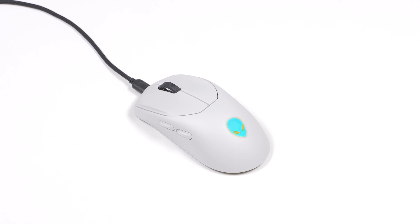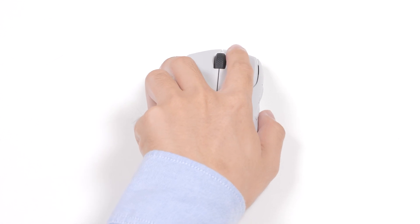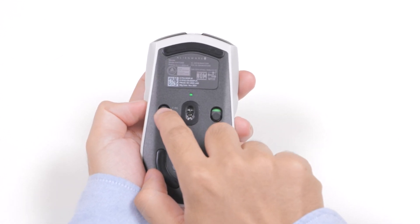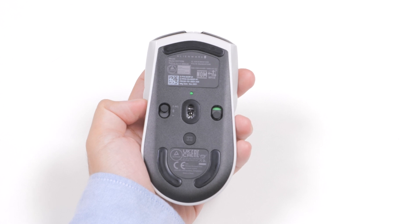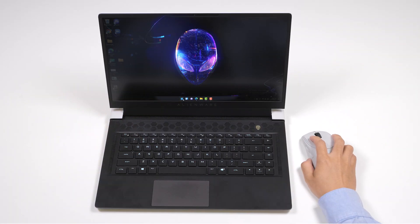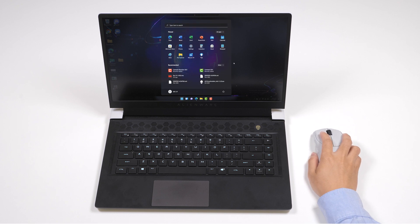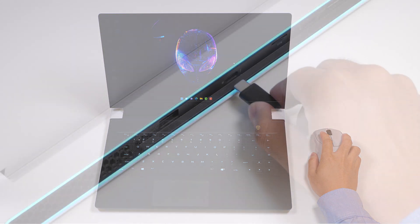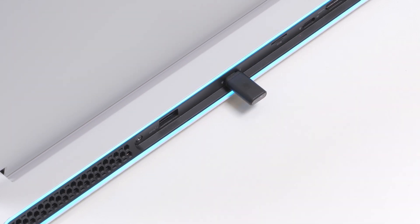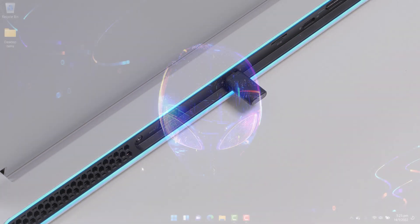You can use the mouse in both wireless and wired mode. To use the mouse in wireless mode, enable the 2.4G mode or Bluetooth. To use the mouse in 2.4G mode on your computer, turn over the mouse and slide the mode button to 2.4G. You can also connect the USB wireless dongle directly to an available port on your computer without using the USB charging cable and the dongle extender.